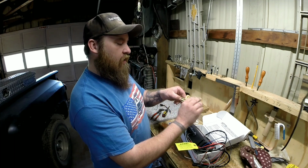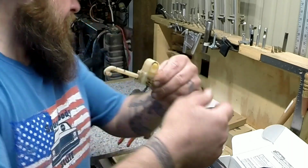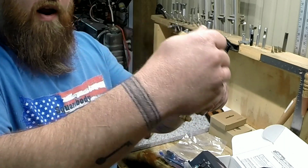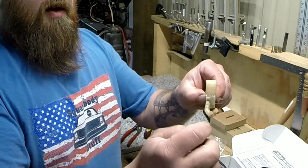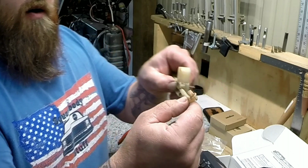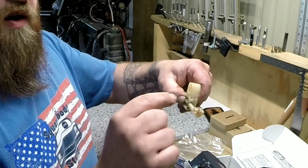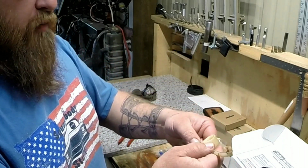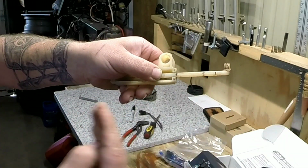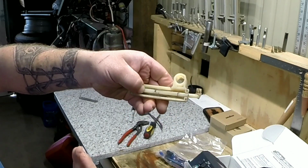I want it to work whenever my clutch is pushed in, and I don't know if you can see this. This right here has a plastic nut and sleeve that goes through there. This is what mounts to the framework of your pedal assembly, and this goes into the actual clutch pedal arm. And I've even modified it. I drilled a little hole so I could put a sheet metal screw through there to make sure it doesn't pop out. So I popped it apart, checked out what I need to do, and made some marks on here. I moved my clutch in and out to where I think I want it, and there's where I want it, and this mark here is where it's completely out.